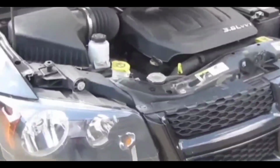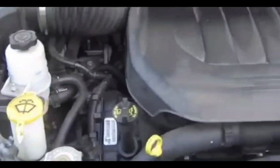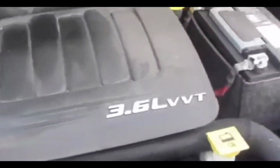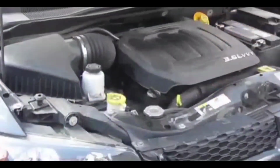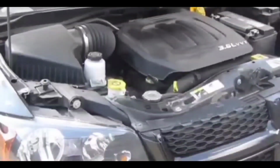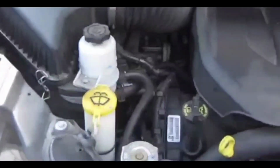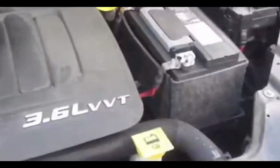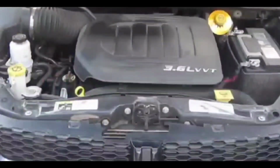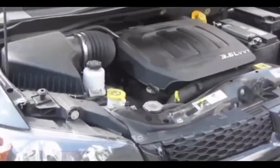Now, granted, if you guys have a good battery and the terminals are clean, you might want to know what could be causing that situation. You guys could actually check the negative cable to see whether it's clean and firmly grounded to the frame. Sometimes if the ground cable is rusted where it grounds to the frame, or the surface area on the frame does not have enough contact area for the cable where it connects, it could cause power situations like that,